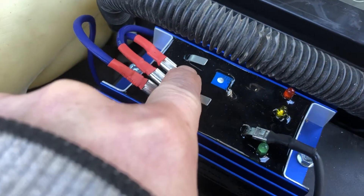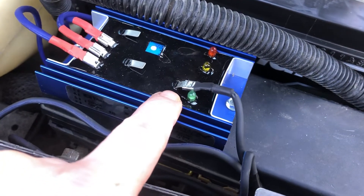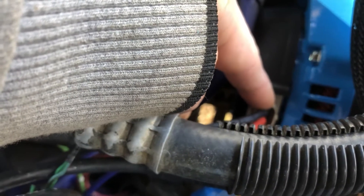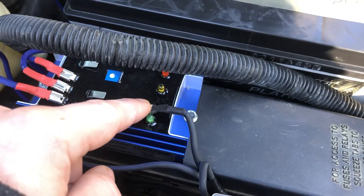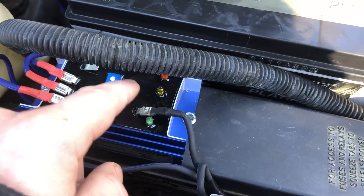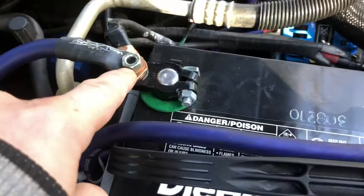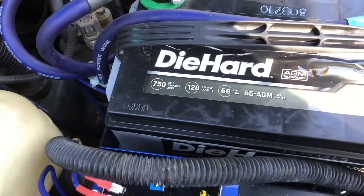You don't use that pin, this one is your ground pin. Your ground is going to come from your alternator over to the pin on the regulator, as well as coming from the regulator to either a chassis ground or a battery negative ground — whichever you prefer, it'll work the same.